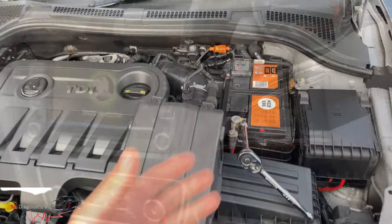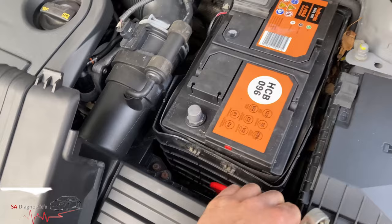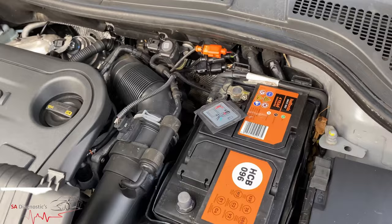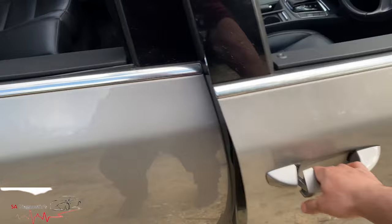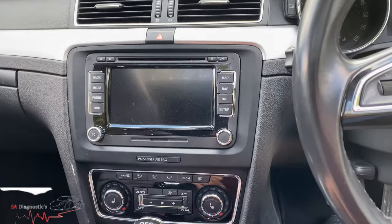I'll show you how to do the reset. Come out of the car, turn it all off, and take the positive terminal off — undo it. I'm going to do both terminals just to be sure. Sometimes it causes more trouble than just solving the problem. Then come back in here and just hold on to it for a minute, let it drain completely.